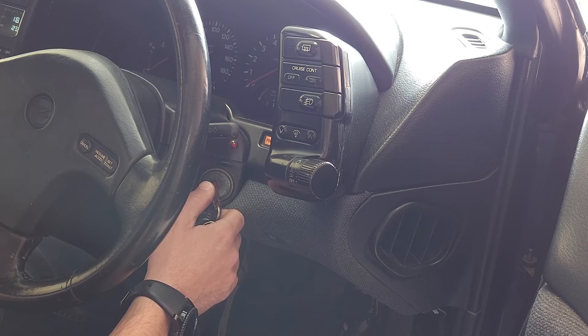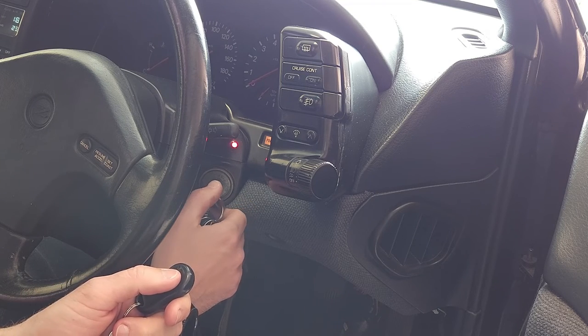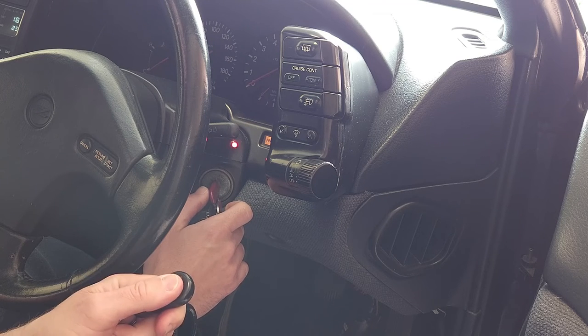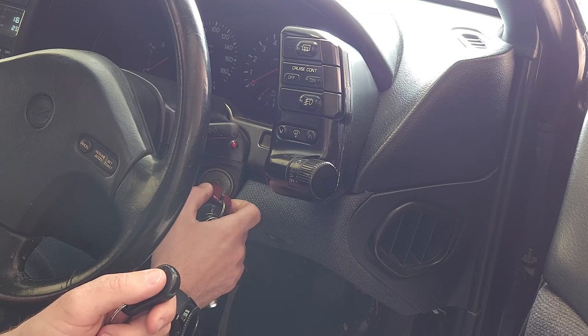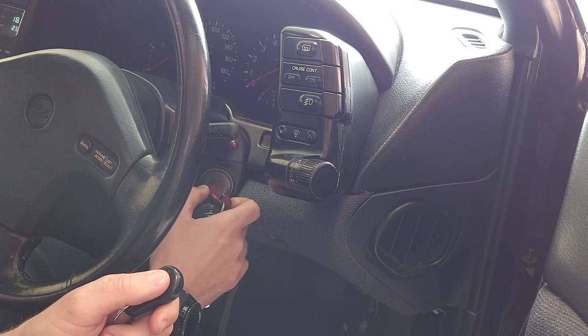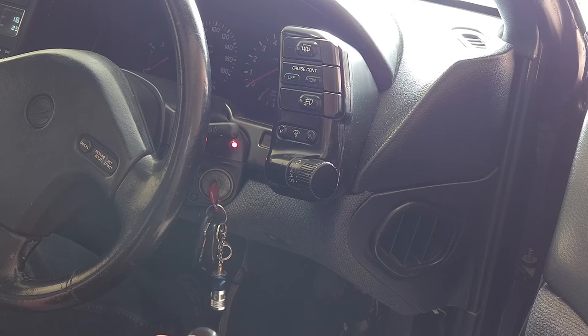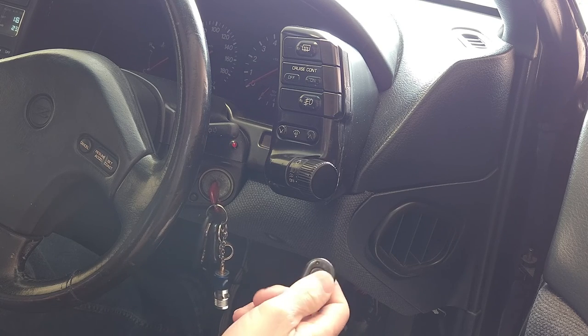Okay, so we're in. Now we turn it off — one flash — turn it back on, we turn it off — one flash — turn it back on, push the button on our remote, wait the two seconds, turn it off — one flash — turn it on, turn it off — one flash — turn it on, push the button again. Now this should flash rapidly if it's accepted your key, and the key should work, and this one does.